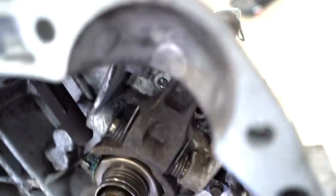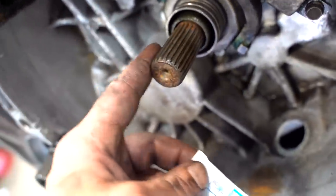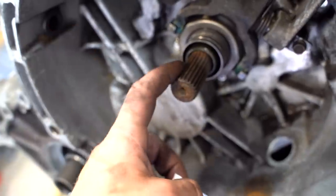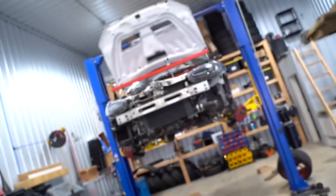We've got her all back together. I put the clutch fork in wrong at first, but now she's in right. They sent some lube along with the clutch — this lube is going to be for the splines. We're just going to put a little bit on the splines, not so much that it starts flinging off into the clutch itself, but just enough so it slides through the clutch discs. As soon as we get that lube on, the transmission goes back in the car.